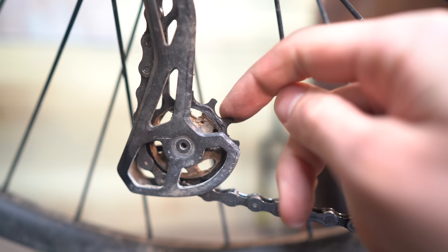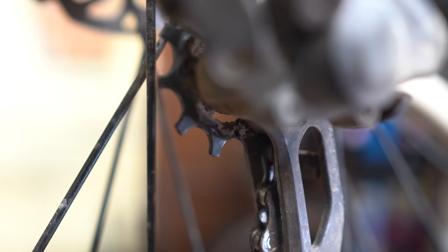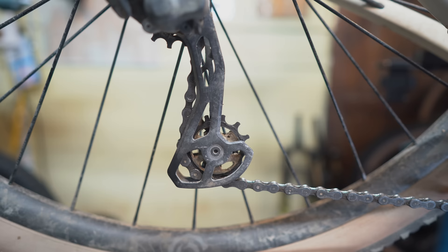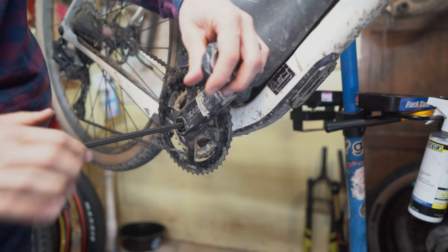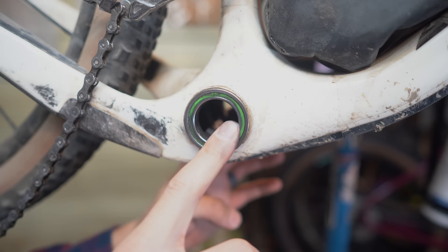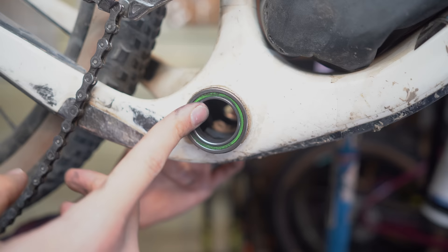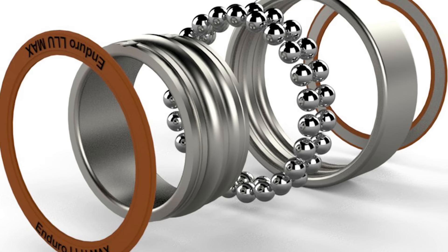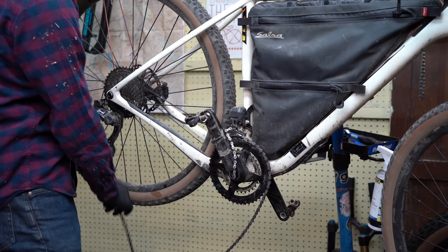The tension pulley wheel looks a little better than the guide pulley wheel. Both are showing some signs of wear; the guide pulley's teeth are definitely sharpening more. Unfortunately these pulley wheels are going to have to stay put because I cannot find any. Finally, looking at the bottom bracket bearings — this Cutthroat comes with a PF92 press fit. These bearings are from Wheels Manufacturing, they're Enduro bearings. The drive side feels really good; the non-drive side has a slightly sticky feel, but both feel really good for 4,000-plus miles. These sealed cartridge bearings are awesome — they have plenty of life left.